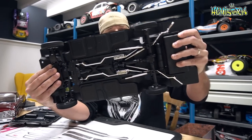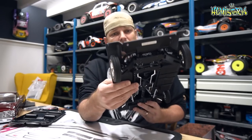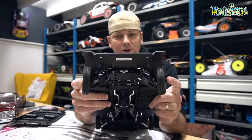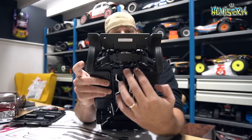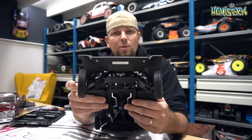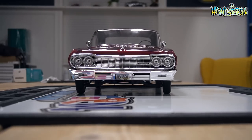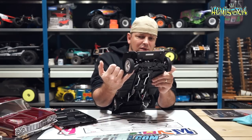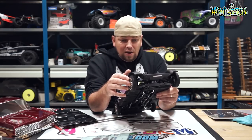On the bottom you can tell there is a scale exhaust installed — fully chromed — really giving it that custom look. I've seen people already going completely bananas adding a ton of chrome on the upper and lower A-arms in the front, and also on that rear axle. Now you can tell that once you drop the suspension completely, it has quite a bit of toe-in at the front. There is an update coming — by next summer I believe, Redcat will have updated this steering rack, aligning it more with the pivot points of that lower A-arm, and by doing so eliminating a lot — if not all — of that toe-in you currently see on a full drop.